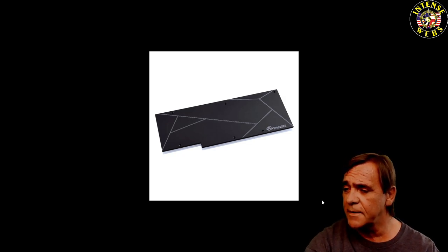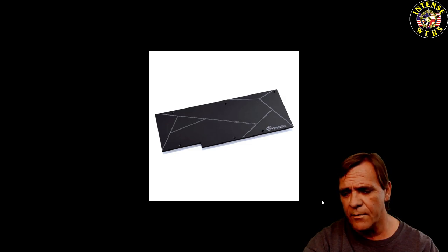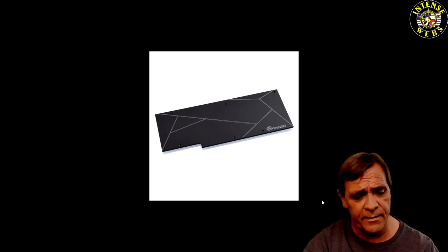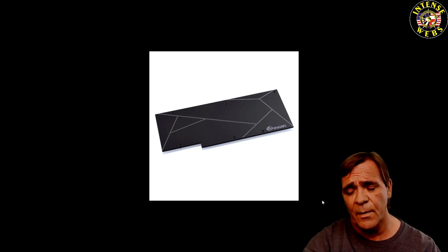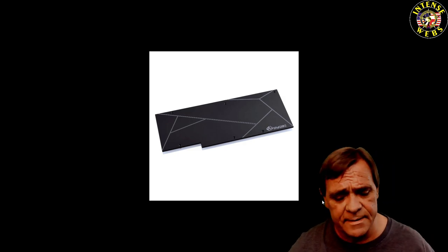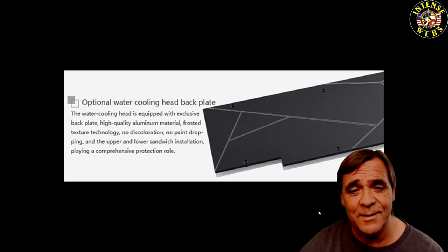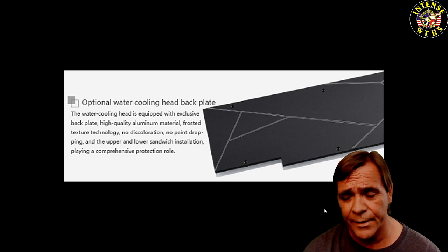You're looking at around 700–800 watts. Some of you are young enough you don't remember those old 100-watt incandescent light bulbs — 60, 75, 100 watts — they used to get hotter than hell. If you're pushing 800 watts, that's about eight of those light bulbs inside of a PC case. That's going to be hot as heck — that's why everyone's looking at water cooling right now.